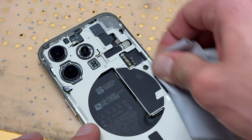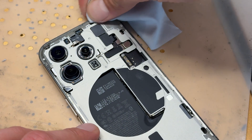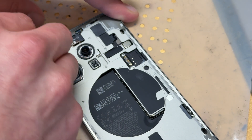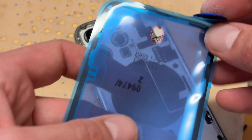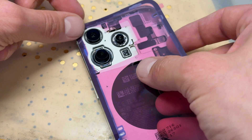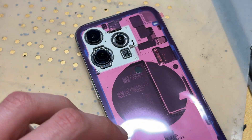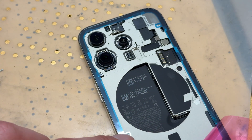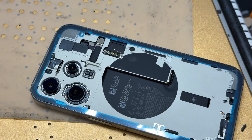I've got a cloth with a very small amount of alcohol on it and I'm not going to take it any further past that point. That's pretty clean — I'm happy with it. Now we need to put adhesive on it. Same as every adhesive installation: start in the top left, follow it through on the left-hand edge. Peel off the top layer and leave the thin blue layer behind. That looks pretty neat.